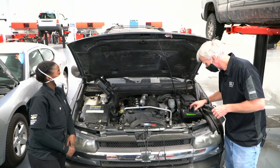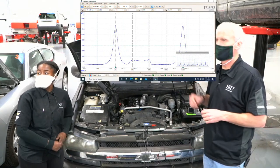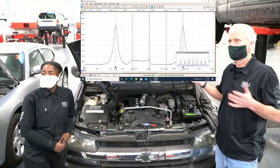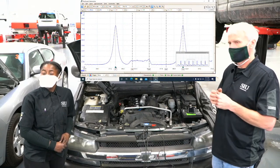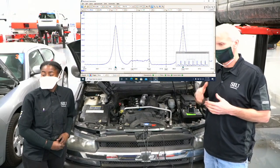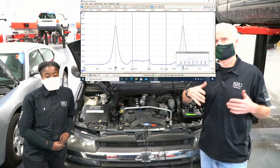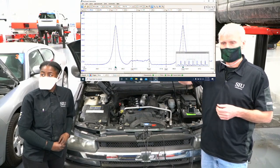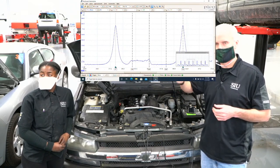So right in the middle of this screen we can see there's a pattern. Bree admittedly said she doesn't have any experience with this stuff, so she can be the student and learn. One of the things this transducer does that's better than a conventional mechanical gauge is it will show you the pressures in the cylinder throughout the four-stroke cycle — we get to see what pressure looks like on compression, then power, then exhaust, then intake, and back on compression again.